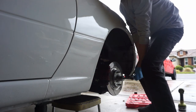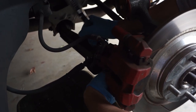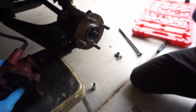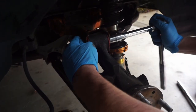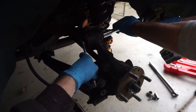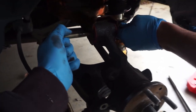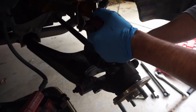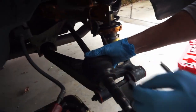We're gonna get the axle out — we had to remove that axle nut and then we're getting the brakes out of the way, starting with the caliper and then the rotor. Now we can remove the top bolt from the upright, which lets us swing it down with a little help from a screwdriver to knock the bolt out, then push the axle out of the upright and pull it down. Just like that, it's apart.